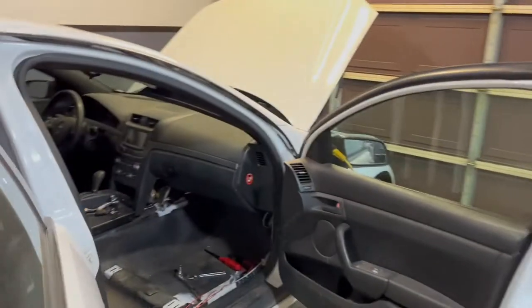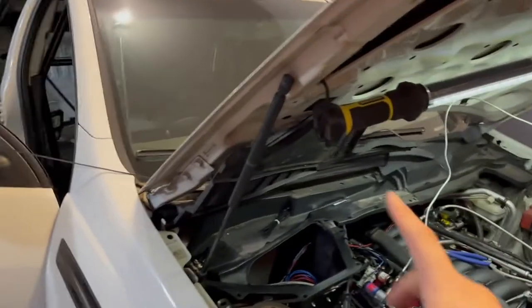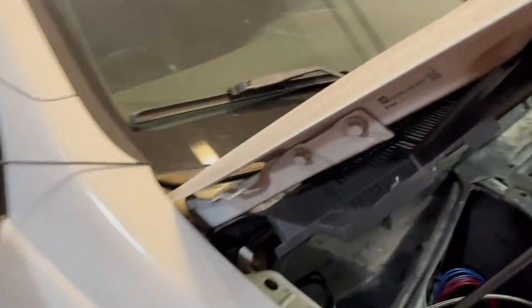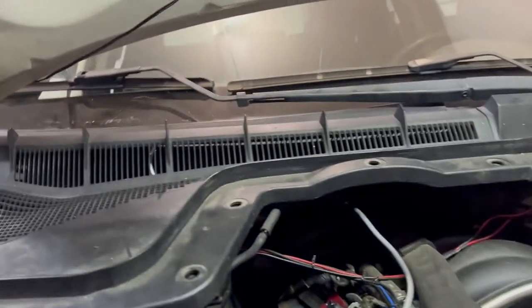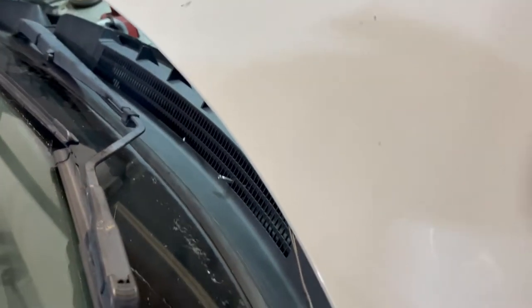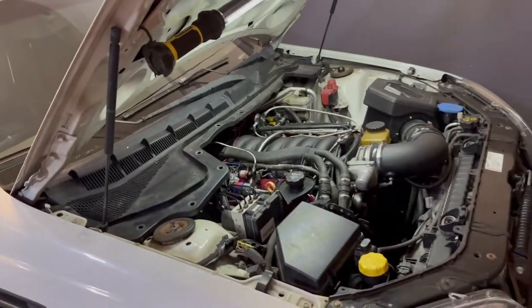What I'll do next to be done up here is put this back together. I'm going to poke two holes in there and run my nitrous purge out of one of these holes. I just popped a hole up there, ran it through about here, and it should come out right there. Once I get the cowl everything put back together, I'll set the phone up and hit the purge just a couple of times.